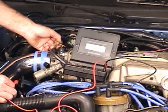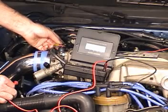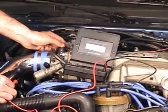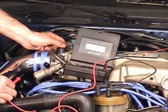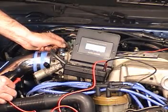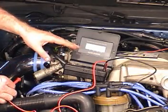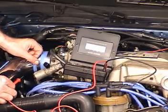You have to look at your color codes to know if that is the correct color. This wire eventually goes to pin 46, which is the signal return connection on the processor, and I should get a complete circuit. I should have a very low ohmic reading here. So let's give it a try.